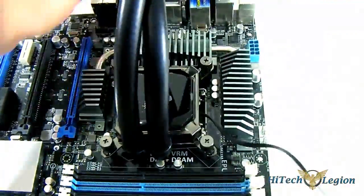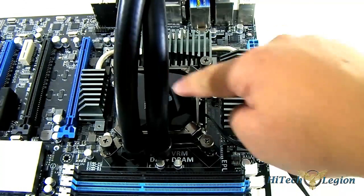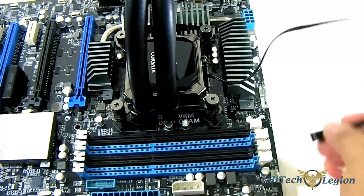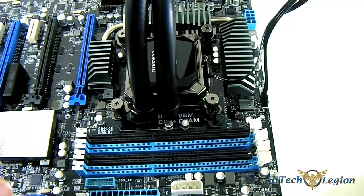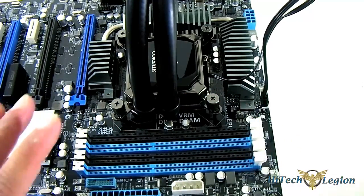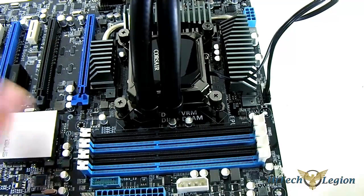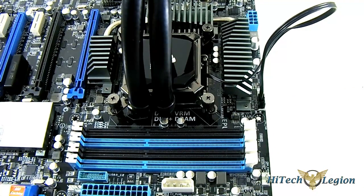Don't forget there is a plastic cover on the pump's 3-pin connector. As long as you make sure to supply it with full voltage — go into the BIOS and make sure that Smart Fan is disabled on the plug that you want, so that it has the maximum 12-volt voltage flowing there, ensuring your coolant is flowing at the maximum flow it could be.